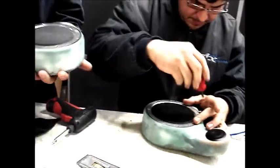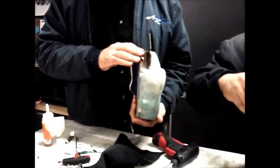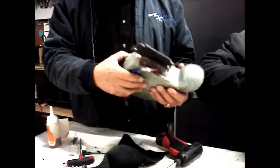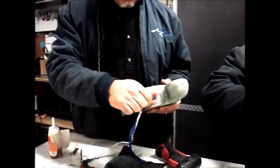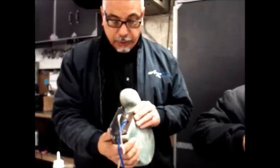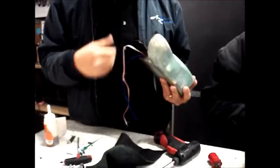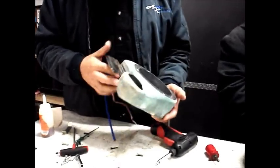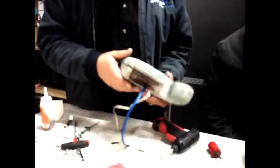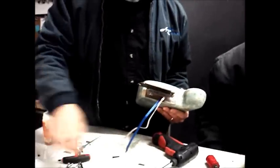Here's a finished picture of a finished one. One of the other cool design elements is this handy bracket Poco welded together. It's held in there from the inside with two machine bolts here and then another machine bolt on this side, so it's very, very sturdy — this thing is not going to move. It's going to be mounted to the hinge of the door, and there's a plastic cover that covers the hinge. It needed to be very sturdy given the speed and suspension on this vehicle, which is going to have 850 horsepower — taking corners pretty fast and probably a bit of a rough ride. Poco spent most of the time working through it and did an excellent job. He is a master fabricator.